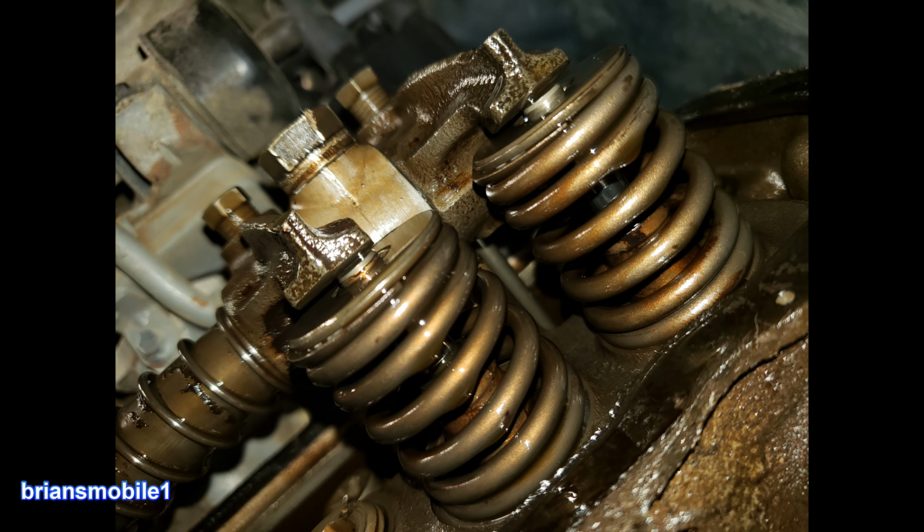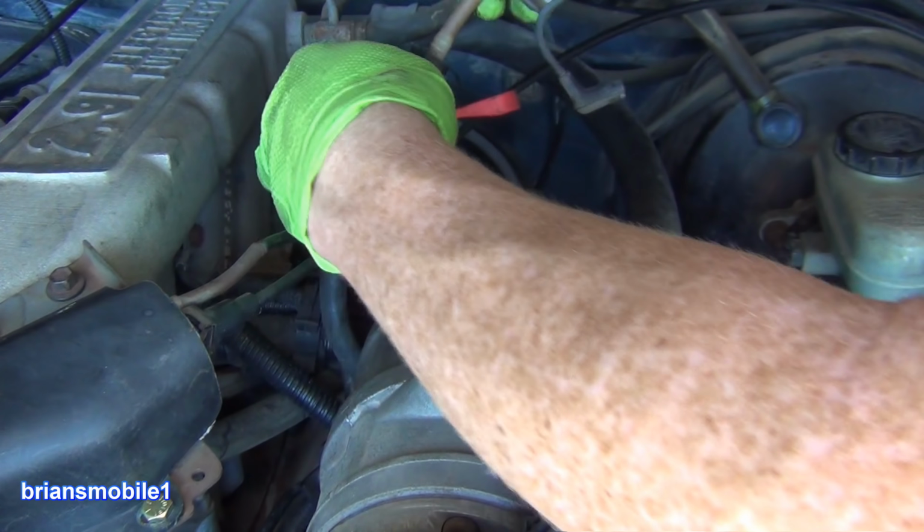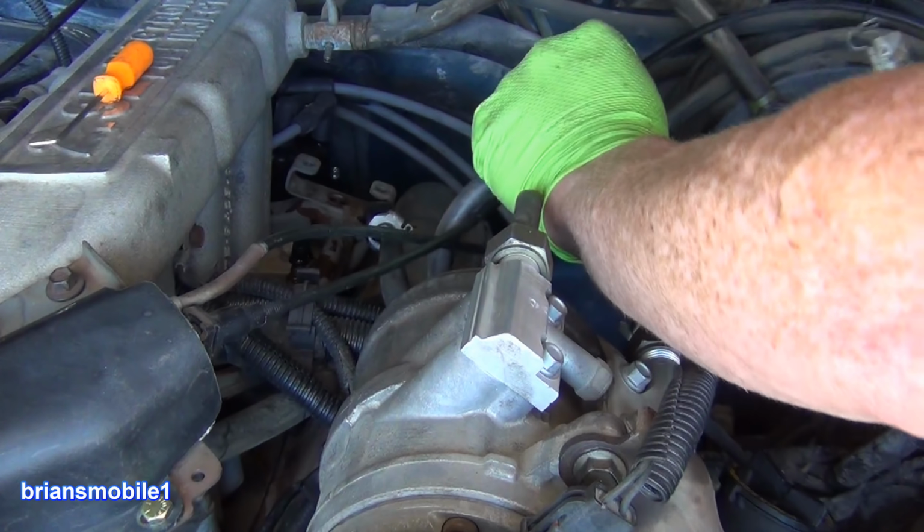From there, unbuckle this guy and then use a fuel disconnect. I like to flush this out with some silicone spray. Silicone can be a glue or it can be a lubricant. In this context, it's a lubricant. And these are my favorite disconnect. I'll leave a link in the description. The reason why I like these is because it hinges clear back here. A lot of them will hinge locally, and then they've got a huge gap to where you don't get a good disconnect going on. Push the lines together. Push your disconnect tool into it.